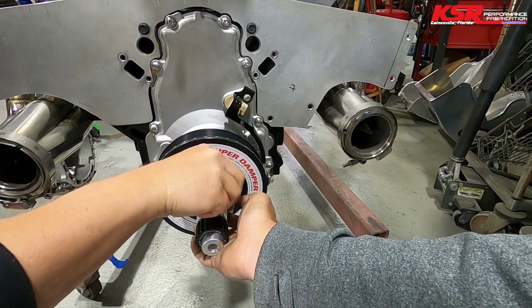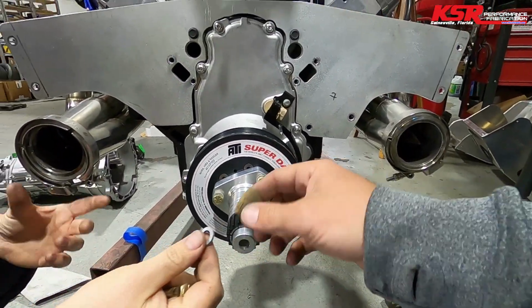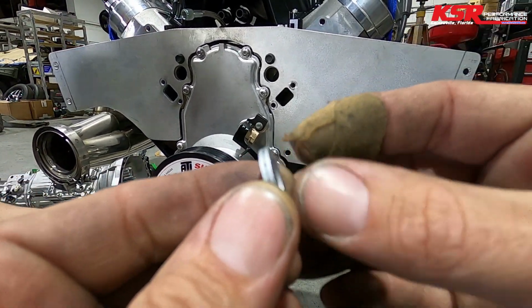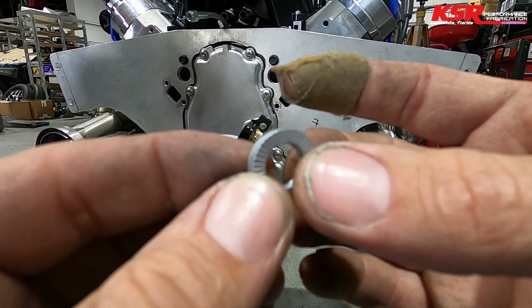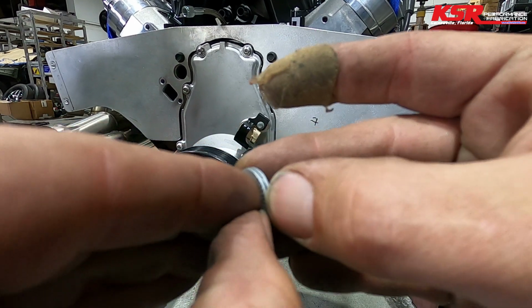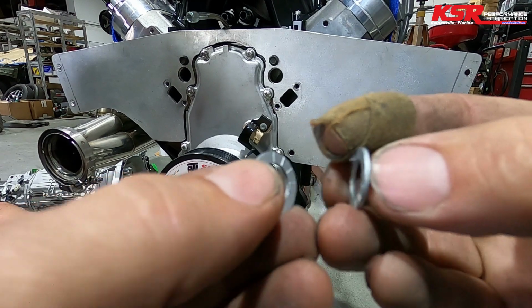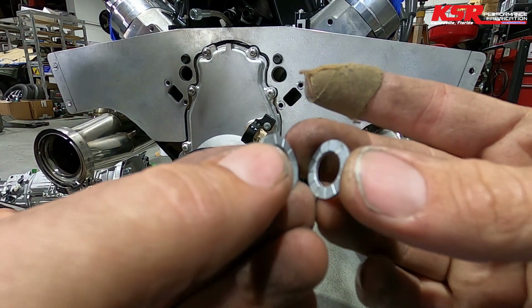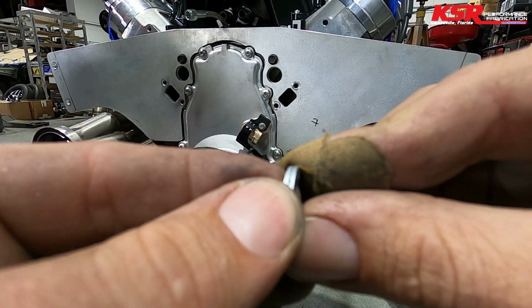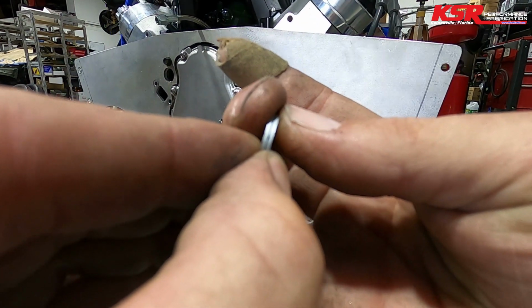It's good bolt length. And let me see those washers. So this is a washer setup that I like to use on a bunch of stuff, and hopefully this shows up on video. These are called Nordlock washers. And if it's clear in the video, you can see there's serrations on these washers. And when they're bolted together, they tighten and everything goes to its thinnest diameter point this way.